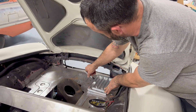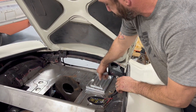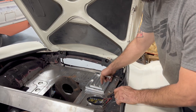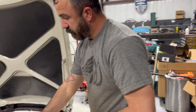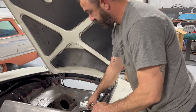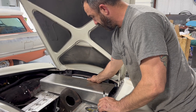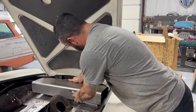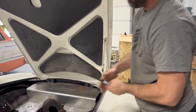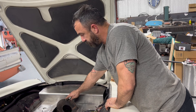We'll cut this out and make a brace underneath that will hold them — just a floating flat strap that comes down and under, bolting those to them on both sides. Then I'll remake a panel that goes over the whole front with the same indention and holes in it. Ideally, I can make it step this way, cut a notch out, and it'll also be a finger guard for the pulleys.